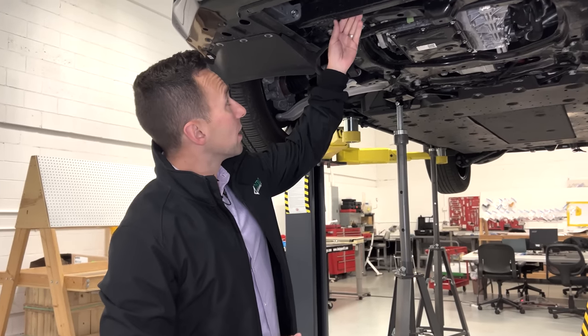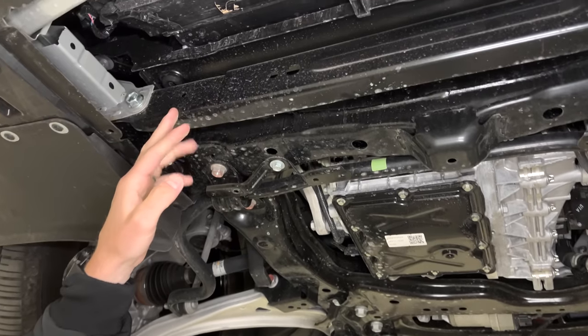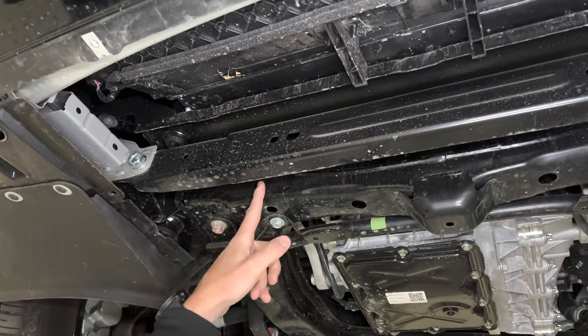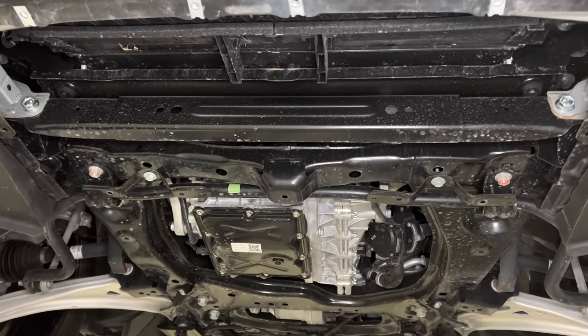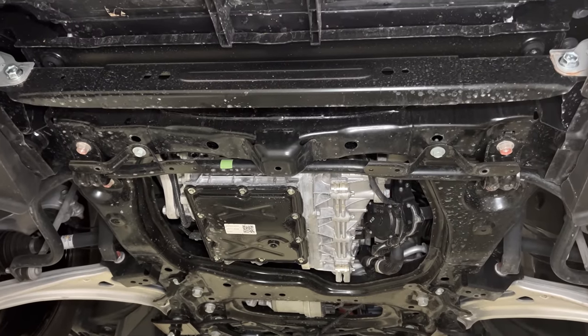And then obviously they are tying in laterally the two monuments at the front of the vehicle with these, which is interesting because they have a cradle member just aft of it. So they've got this piece right here, and then just aft of that, they have a cradle cross member. They're likely doing that to stiffen this whole front end, once again, from a SORB perspective.